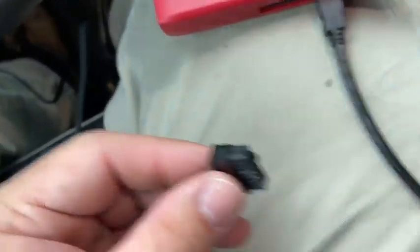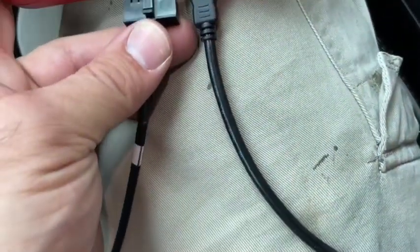Up in here you can see these green blocks with the little white connectors. You're going to go to the one closest to the actual driver — there's one with two rows and a single row; don't go to the double-row block, go to the block further up that's closest to the driver, which should be open and easy to get to. Once your cable is hooked up down there, plug your power source into the 12-volt USB or the cigarette lighter they provided.